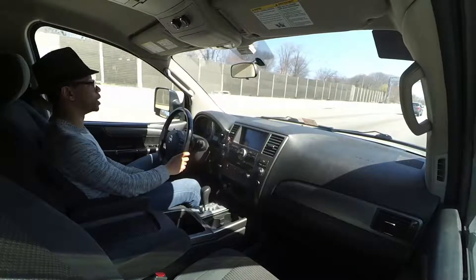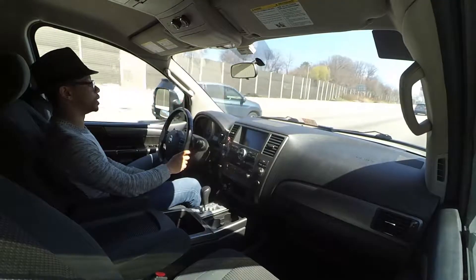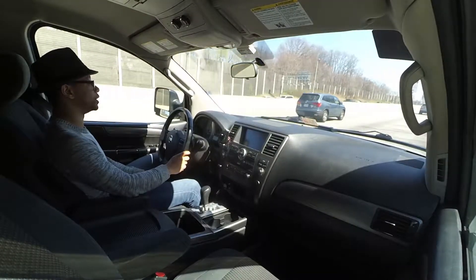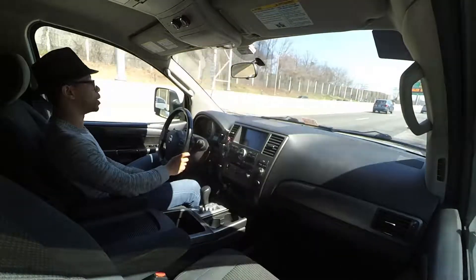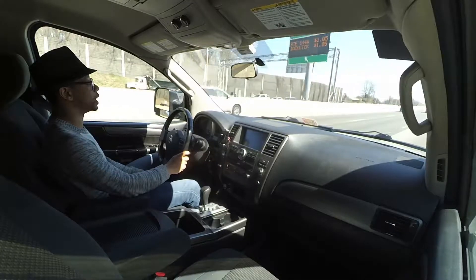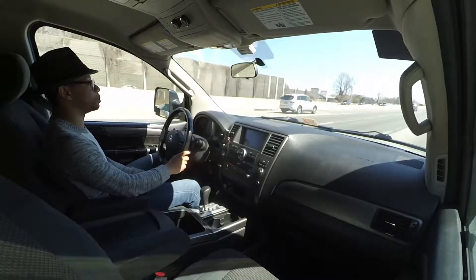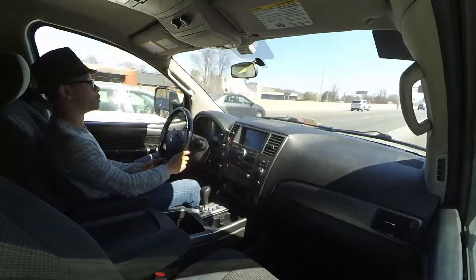It's one of the easiest things to add a transmission cooler, so definitely do that if you see that the transmission temperature is getting too hot. This is really particular to towing — it's a big thing when you're towing. Some cars don't pull well and have a shorter transmission life. You could do some research and even on a regular car, you can take advantage of a simple upgrade to increase the life of the transmission.